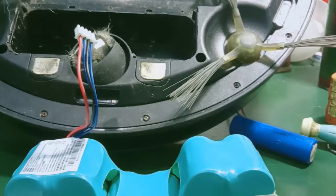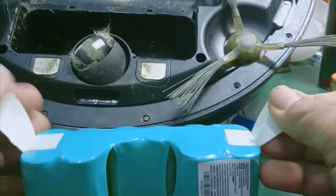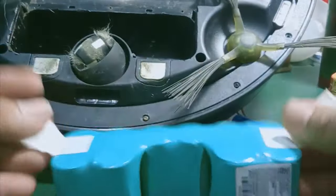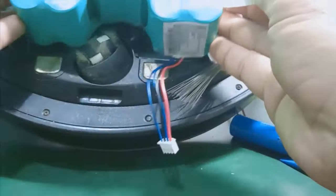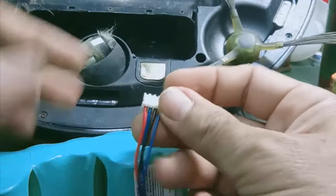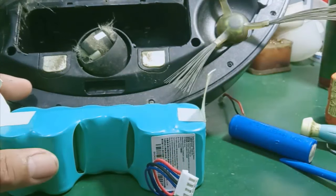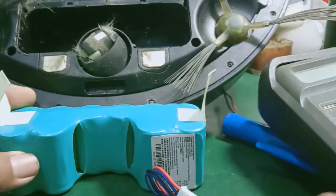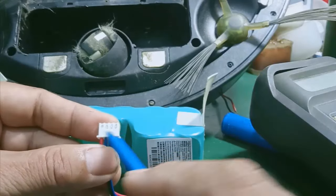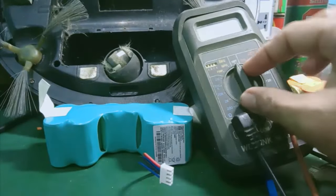To replace the battery easily, first position the 2 pull-tabs facing upward — not downward — so it's easier to pull out later. For connecting the socket, you can bend the connector head slightly. With a new battery, you can use a VOM multimeter to measure the voltage between the black and red leads (B+ and B-) — the B1 and B2 leads don't need measuring. Set the meter to DC 20V range.